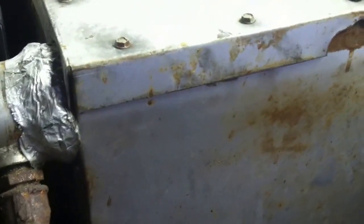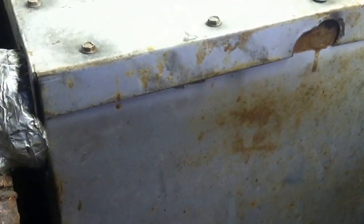I do have other boilers, typical boilers that would be used in a steam car. Many times when the standard boiler would go bad, back in those days they would install an Oldfield boiler, and it was a steel drum, and it was soldered up, or welded up actually. Sometimes they used copper, a combination of copper and steel, depending on who was building it. So those boilers were upgrades to the other boilers.